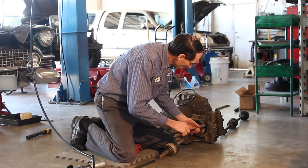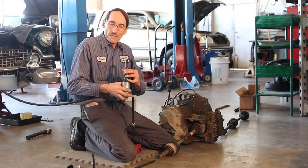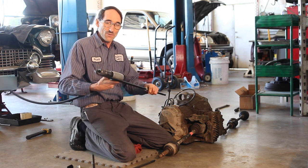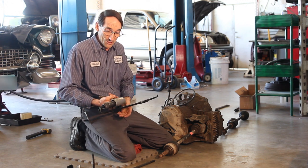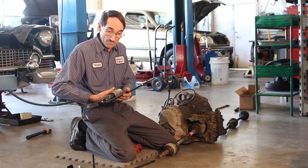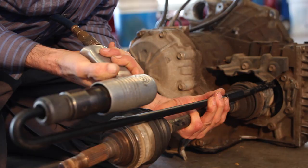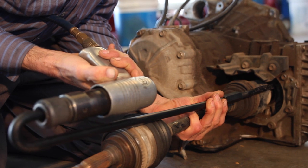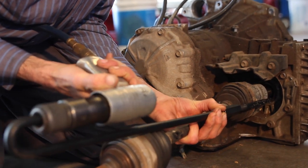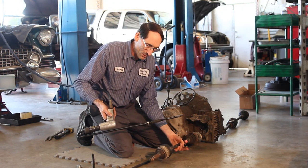Make sure I can get a pretty good grip in a couple of spots. Like any kind of pulling or chiseling, there are many variations of air chisels. If you're doing axle work and heavy pulling, you want to make sure you have a heavy-duty, high-power air chisel. And we can still get it out without making a huge mess or having it fly across the floor.